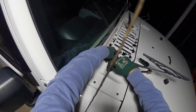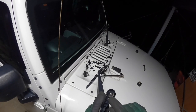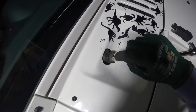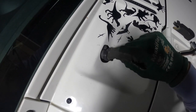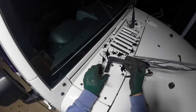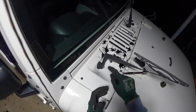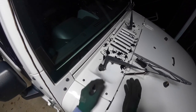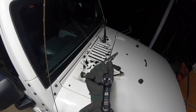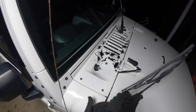Just give it a couple of wiggles — as you'll see there are a few grooves in there and it just wiggles out. If this is your first time trying to get yours out it might be really stuck and corroded inside these little grooves, so you might just have to be a bit more patient. Mine's been off before; you can see there's a lot of dirt built around the base of the sleeve. Just give it a bit of time — it slides on there and with the pressure of the nut plus dirt and corrosion it might be a little rusted. Wiggle it back and forward and pull straight out. You can see those sleeves in there that were holding it in. That's pretty much it — you've got free access to take this cowl off. Repeat the same for the opposite side and you're good to go.